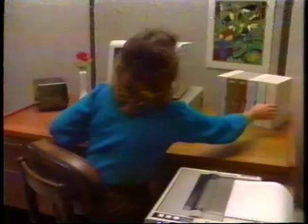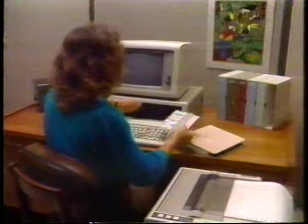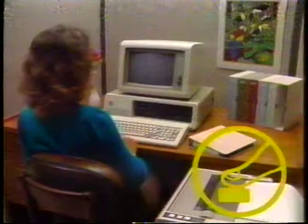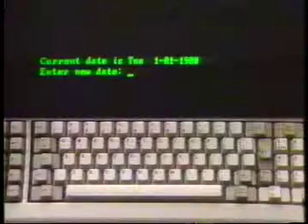Find the disk that came with your IBM personal computer labeled DOS diskette and insert it into the left-hand drive above the keyboard. Close the door to your drive. Now reach around the right side of your computer and turn on the power switch. You'll hear the power supply warm up then beep for test. Notice the flashing cursor on your screen. Next you'll hear clicking and whirring sounds from the drive and the red in-use light will come on the front of the drive unit — this is when the DOS information on the disk begins to load into memory. DOS is starting.